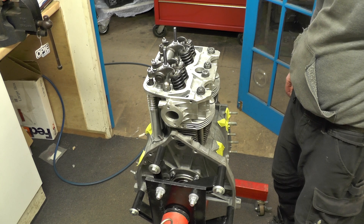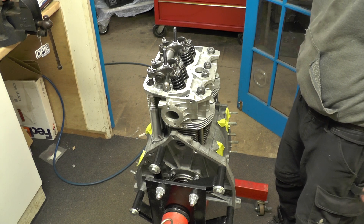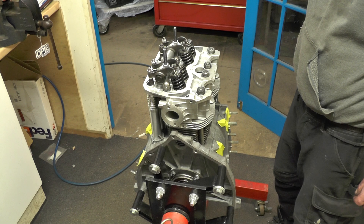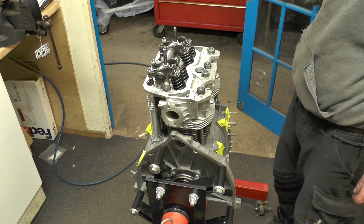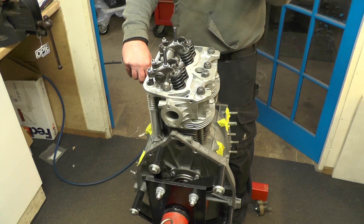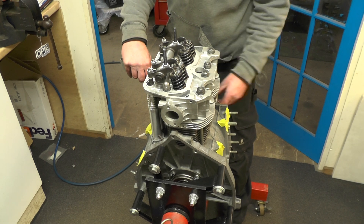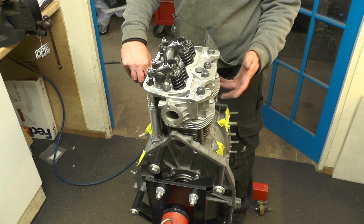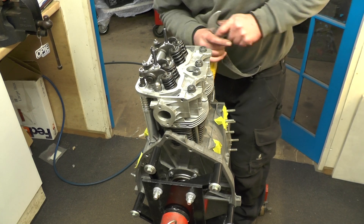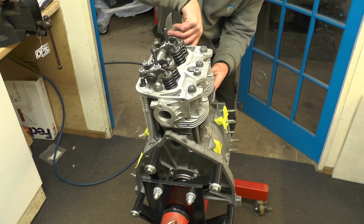You just do that through the opening move — often you just put a screwdriver in the carb. Although I've got no view of what the revs are. We could lend you a multimeter or a timing light that would tell you that. You should also be checking the timing before you do that. The theory is that because it's revving you're slinging oil over onto the camshaft — otherwise it doesn't really get oil at idle. The other risk of running it without being loaded is you glaze the rings, but that's where the special running-in oil comes in. I'd never heard of running-in oil before.